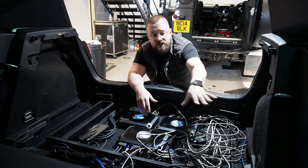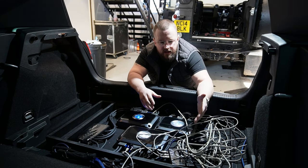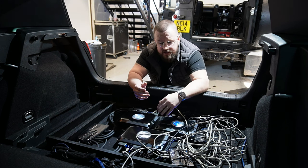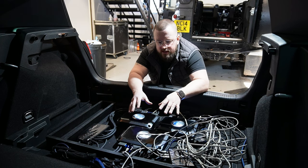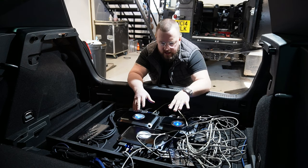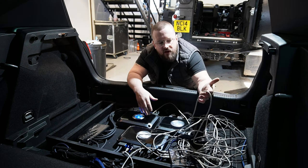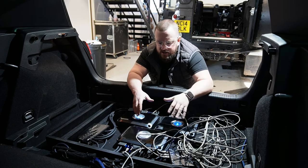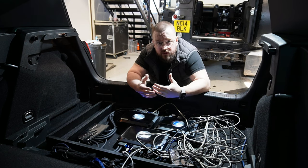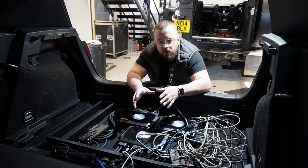The rack is complex. What you'll see in here is the loose lay I had to do last night to get control of all the amplifiers in the Tune software from the VXI hub. You'll notice this light's flashing — that means we've only got control of that one at the moment because I only plugged it in for 10 minutes. I haven't worked out quite yet how to switch all three onto the same network, but that'll come in the next 10 minutes. I've had to order shorter Cat 5s — something I didn't consider when we started. Usually we've got Cat 5 around, but all ours are five metres long, which leads to a more complex rack. Our in-house products don't require any of this — we can go straight into the amp board and things look a fair bit neater.